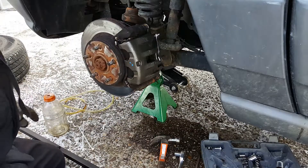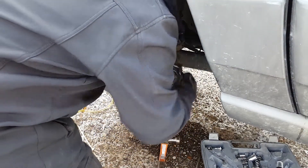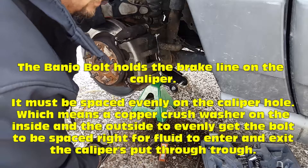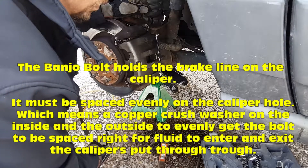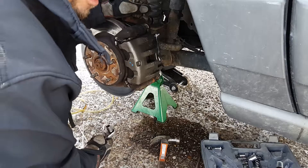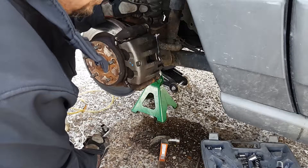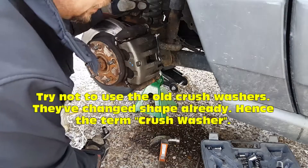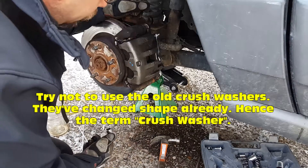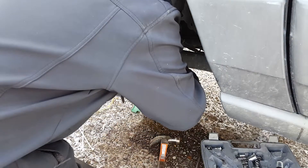Alright folks, I had to take a moment because it was too freaking cold — I was getting sharp pains in my thumbs. Now let me tighten down that banjo bolt. Make sure the copper washer is on the inside and the outside — they have to seal. Some people say to reuse the old ones, but here's why that's a bad idea: I worked at a commercial center and we had some coming back still leaking. Once you press that copper in it seals to the formation of the metal; if you change the metal, that formation changes. Don't over-torque because the banjo bolt is hollow. Use new washers and save yourself a headache.